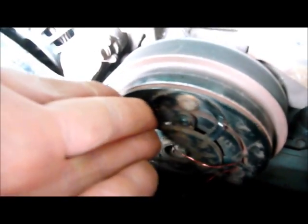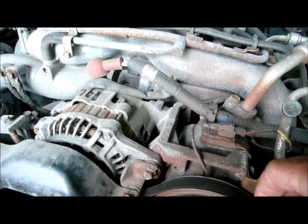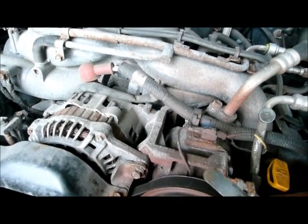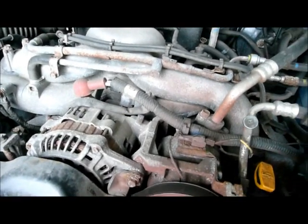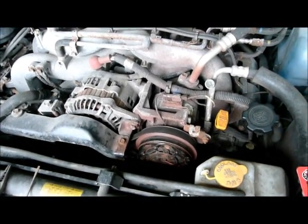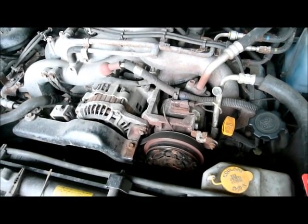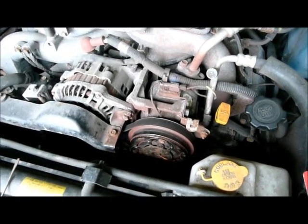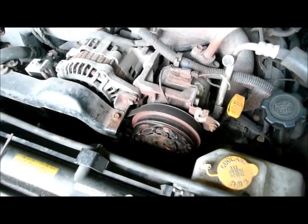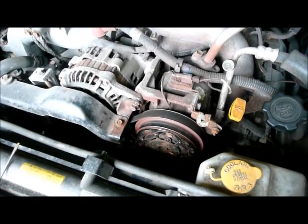All the wires are done and trimmed and epoxied in position. I was able to get this gap down to six thousandths of an inch, but from what I've read you want at least 11 to 13 thousandths, because as things heat up it's going to expand and you don't want the clutch dragging. I hope I haven't offended any air conditioning specialists — I'm not one. But I needed to find an economical way to get around a poor design, and so far this seems to do the trick. So have a nice day, and I'll see you next time.